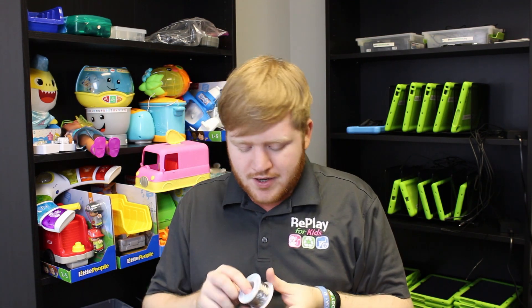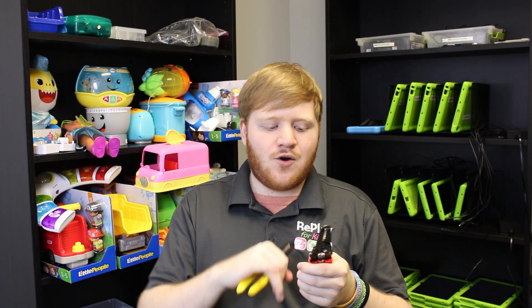And solder — definitely need that for the process. We're using both pairs of wire strippers in the volunteer toolkit today. One is 10 to 22 gauge and the other is 20 to 30 gauge. The larger the gauge number, the smaller the actual gauge of the wire. The pre-cut speaker wire generally only needs a 16 to 18 gauge wire stripper, but most internal toy wires — especially in plush toys, bubble machines, stuff like that — tend to use thinner wires, so you'll be using the 24 to 26 gauge more often.